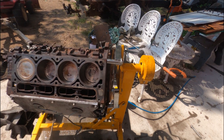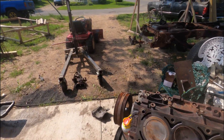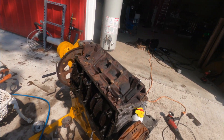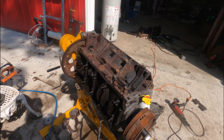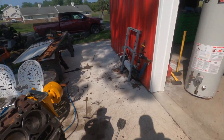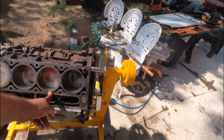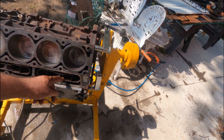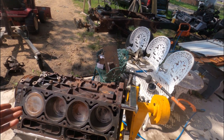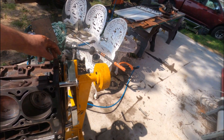Alright, so we're halfway there. You may have noticed my engine stand only has two bolts in it. I really need to pull the hoist back up and pick it up so I can figure out how to get a third bolt in it. I've been putting it off trying to rush. So I'm going to pause the time lapse here. You see what I did - gently wire wheeled the deck surface. I know what the comments are going to be: 'This guy's an idiot, you're an idiot if you grind on your deck surface.' I just wire wheeled the carbon out, mostly, and we'll go from there.